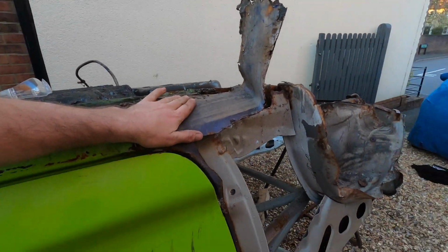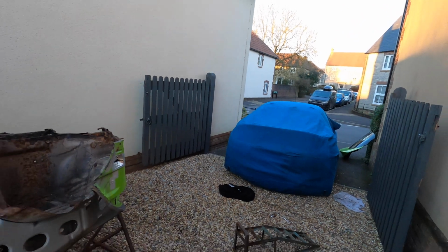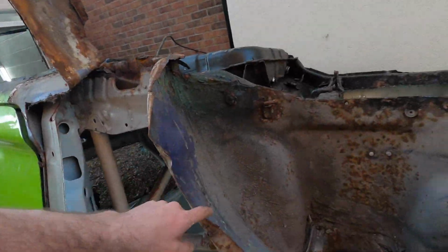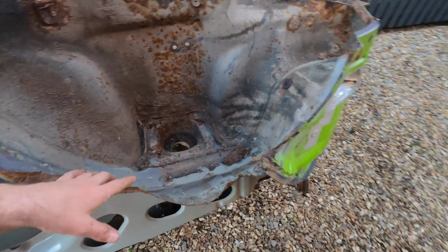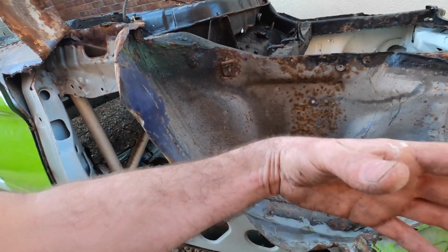The rear arches weren't fitted properly, so when I refit them, I'll make sure they're as flush as the Racing Puma. I'll make sure they're decent. I will take some measurements off this car to see whether they actually cut in here, to make sure it joins, because they had that space in between, whereas I would quite like to find the correct width and join it in properly and weld the line in properly.